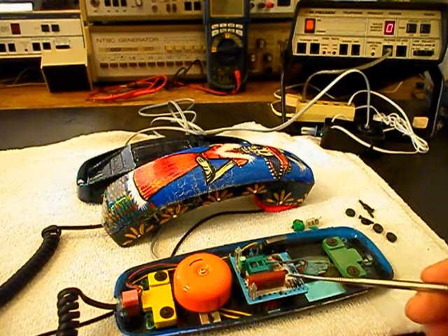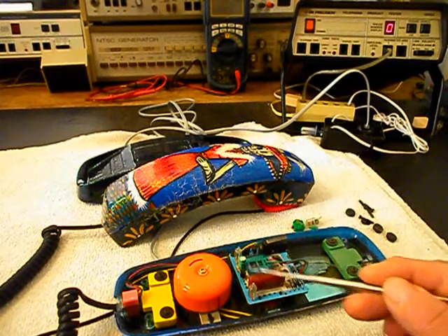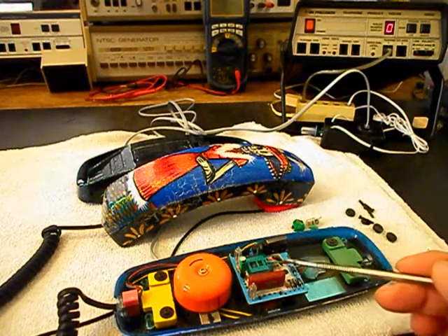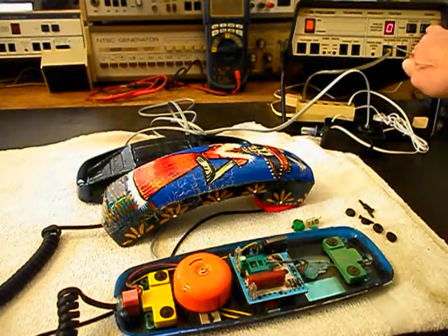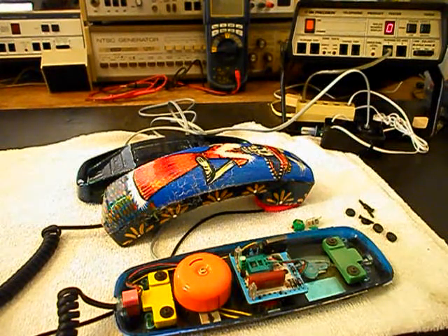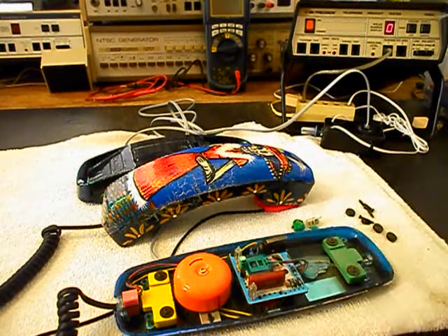That's because this circuit — and it's not uncommon in this type of telephone — after the circuit has got some age on it, when the ring cycle comes through, it's going to saturate the circuit. It's going to short the line for a second and take the bell out. So let's go ahead and ring the unit. And it only rang one time, seizing the analyzer so it can no longer ring. This circuit has to be repaired so that it doesn't saturate on a ring cycle.